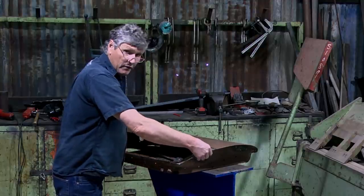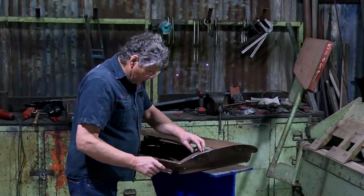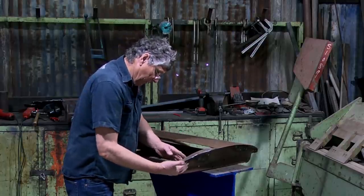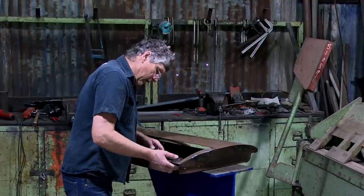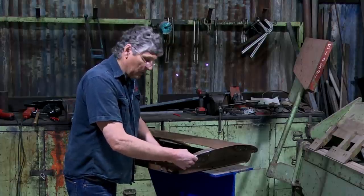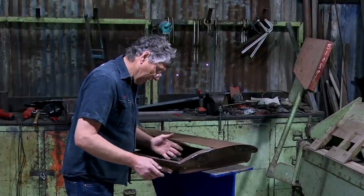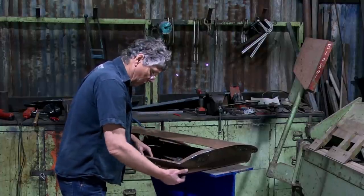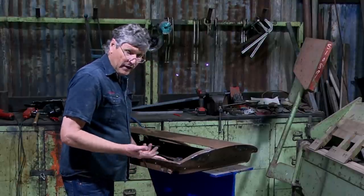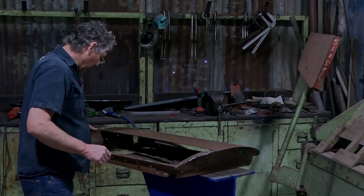It looks to me like we're going to be making a piece to go in here, down to the bottom, probably this area in around here as well. We can make a lot of that by doing our shaping on top of the original because, although it's rusty and pitted, it's quite solid. We can make a piece on this side of it, then cut the corner out and put that in there. We've got this lapped up little box section in the bottom to do, and we've got the hole where the speaker was put in the door decades ago — we can repair that as well.